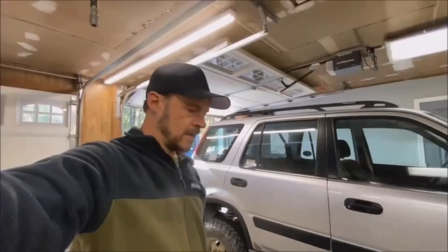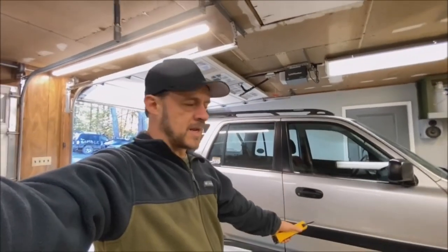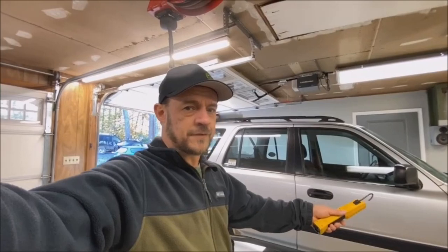More importantly, we discovered a huge difference in height between aftermarket brand A, aftermarket brand B, and stock. The ultra powers actually lowered the car from stock — it was sitting a little low in the front. After we broke those and replaced them with the Gabriel struts, those gave us an additional inch of lift beyond those original cheap replacement ones. That's why we always say results may vary — a lot of people put these kits on and replace the struts at the same time, so you're not getting an apples-to-apples comparison. All total, we ended up with about four inches of lift in the front and about five inches of lift in the back.